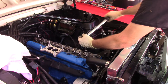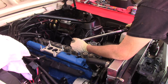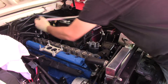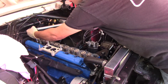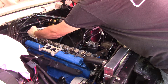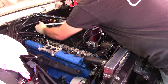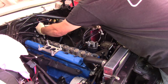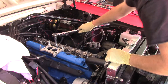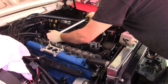See what I mean about the torque wrench — you run out of room pretty easily. Keep that in mind because you don't want to get to a point where you can't move the torque wrench anymore and you're close to torque and then you stop, because the stiction will overcome the torque and you actually won't get it up to value. Make sure you leave yourself enough room to be able to swing it. So that clicked 40 — see, you don't want to do that.